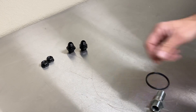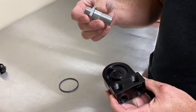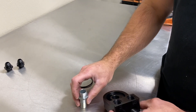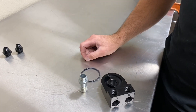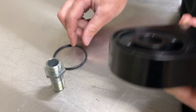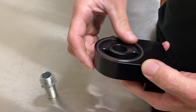Pretty basic — you just take off your oil filter. Behind it there's going to be a bolt like this holding the oil filter on, so you'll take that bolt out. This kit is just going to come like this, with those three parts. Once you take your oil filter and the bolt off, you're just going to take this o-ring, put it in the groove — just like that.